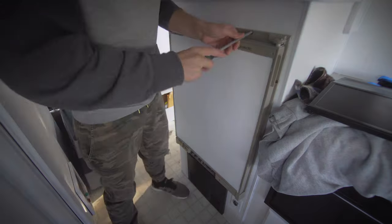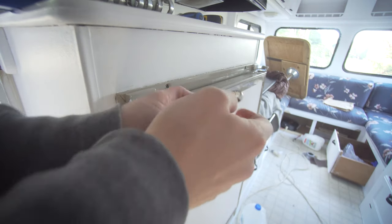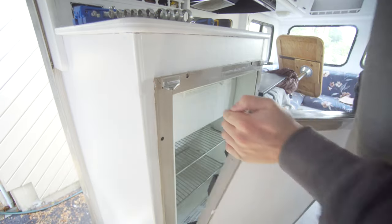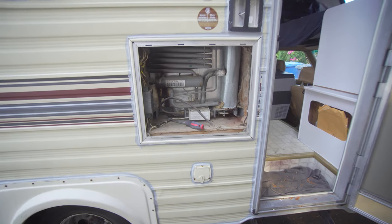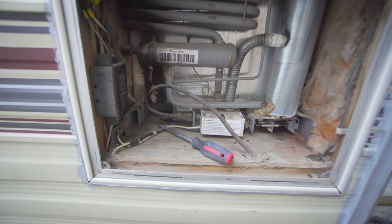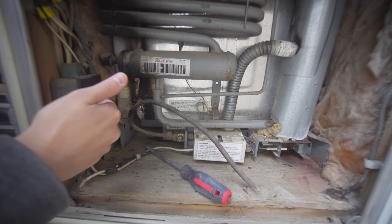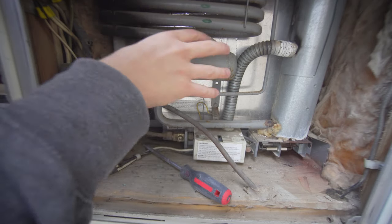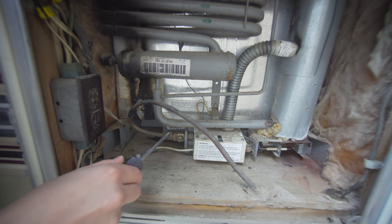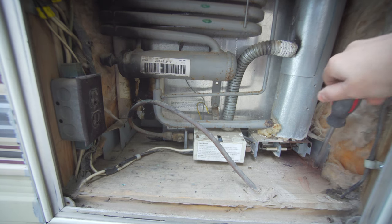Let's start attacking this fridge. I'm taking the door off to get at these ones here. So this is the back panel here. We're going to take a look at what we can detach and what might cause us some issues. This is all the 12 volt system right here. This casing can come right off - this is for plugging the fridge in through the 110 volt. This is all the cooling system and a venting system for the propane. Here's the propane right here. Just apply a wrench here and here and twist off. I'm going to take these screws out here - there's another one right over here. That's what the fridge is sitting on.